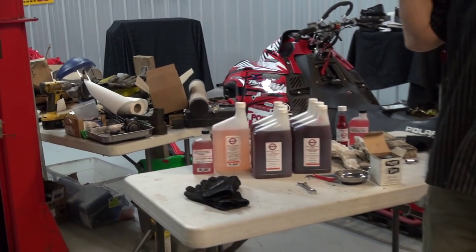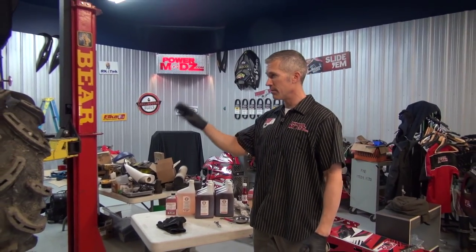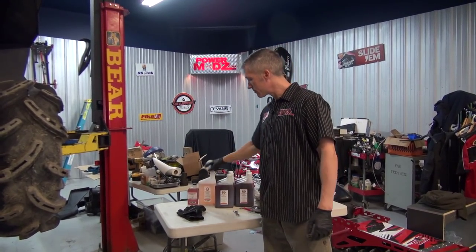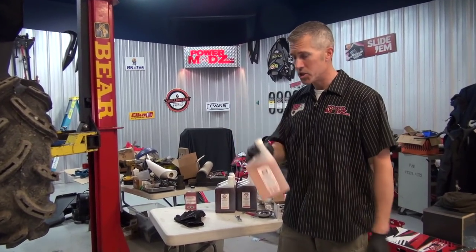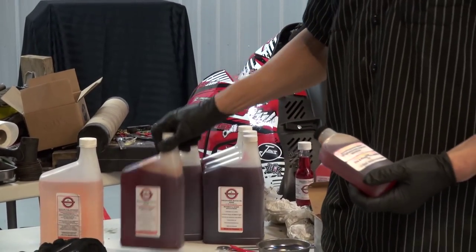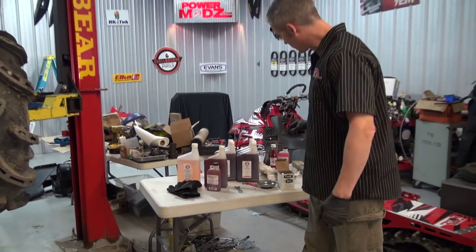First, I'm going to do a little bit of a tune-up as far as lubrication goes — lubricate all the fittings and change the oil. The fuel is from last September. It's full but it's old, and fuel doesn't last long anymore. So I've got this Shellburn enhancer, Shellburn four-stroke oil, and Shellburn oil additive. Let's get that done. I'm gonna show you how — it's very easy. You even have an oil filter.